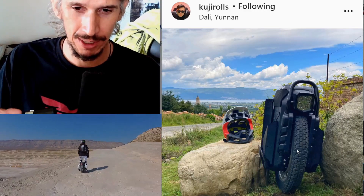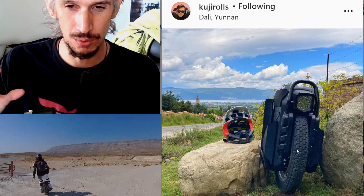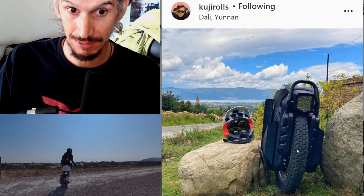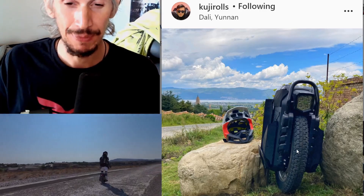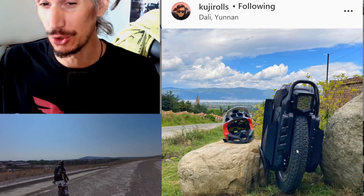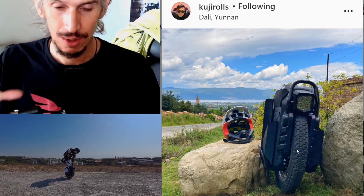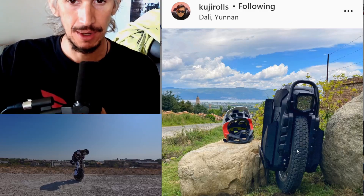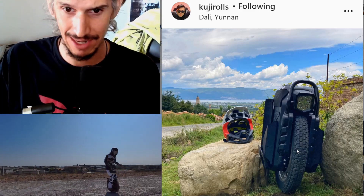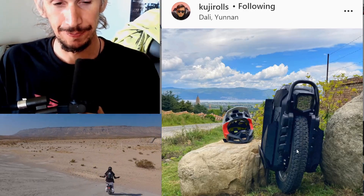First off, comparing it to the Sherman, the Commander, the Monster Pro, or the EXN, I think it will lose in range. It's not going to have as much range as even the EXN, because even though they have the same size batteries — both have 2700Wh — it's a bigger wheel. And if E-Wheels, which I feel is an overpromise, is saying this has more torque than the Sherman, then it's going to eat through that battery really fast. I have what I think is the closest thing to the Abrams — the EX — which has the same size motor, a 3500W motor and 2700Wh battery.